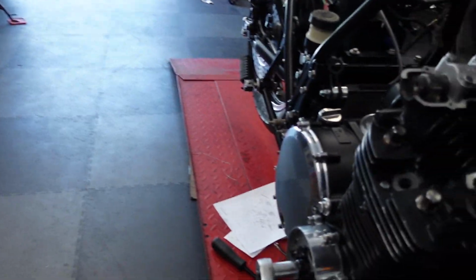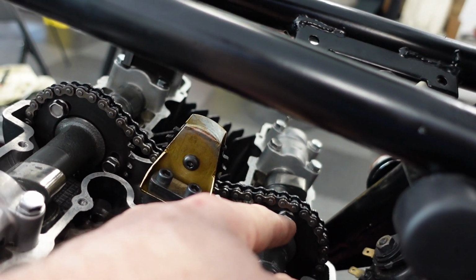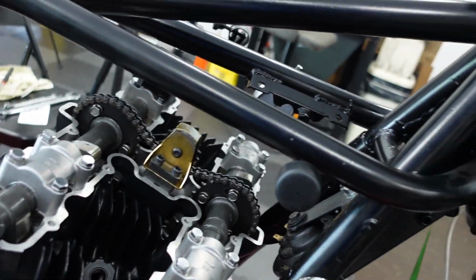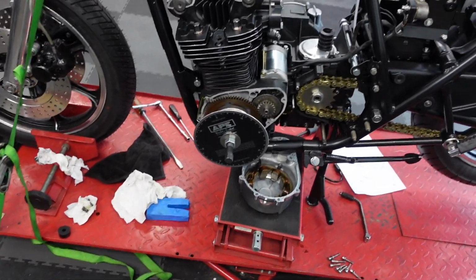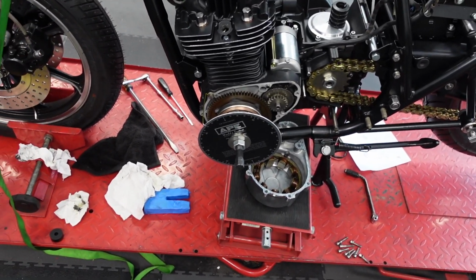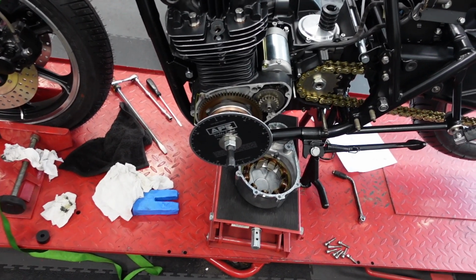And looking at the sprocket, that gap, the more I go and fill in that gap, move the sprocket forward, the more retarded it is. So there's plenty of play to retard it. Okay, well that took 3.5 hours yesterday, another hour and a half, hour just now. But I think I got it.